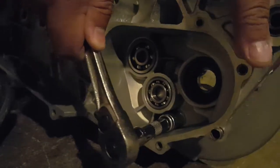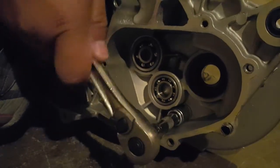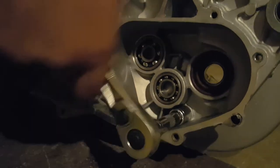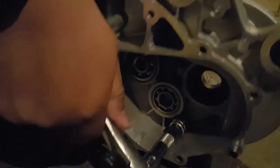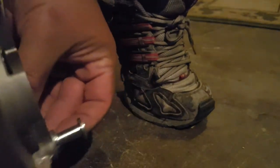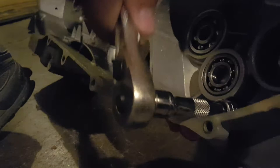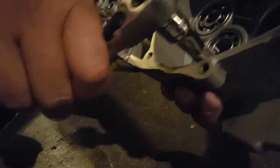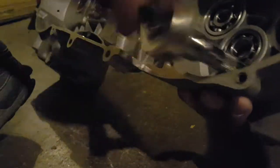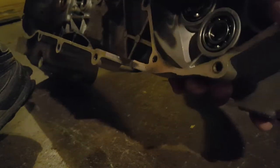It's really tight in there. I think this side might be spinning — no, it's not spinning, so it's good. I want to make sure the back part right here is not spinning, and it's not, so we are good. Go ahead and loosen it all the way. Yeah, this is what we needed to seal our transmission gear. It's unfortunate we have to take out the whole CVT and everything back just to get this, but that's okay because we're going to put our dowel pins in anyway. We need to put the two dowel pins for the CVT cover, so that works out.